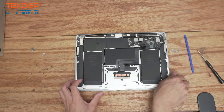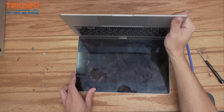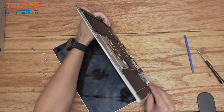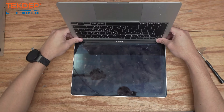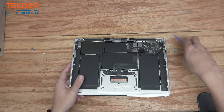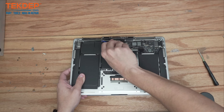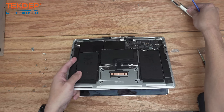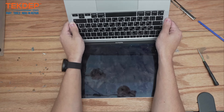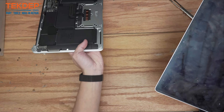Since this one's really glued in there, I'm actually going to open the unit and see if the hinges help pop that WiFi vent module off — and it did. We're going to hold these hinges in order to close them, or else you will damage the top case or the LCD. Let me get under there with a pry tool. That adhesive was really on there. We're going to set that WiFi vent module aside and continue opening the unit, then pull the top case off. This is our bad LCD — we'll set this aside and keep our top case nearby.